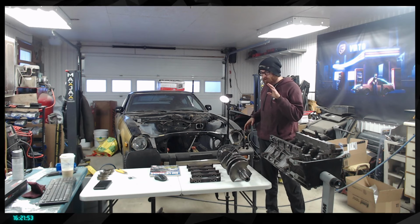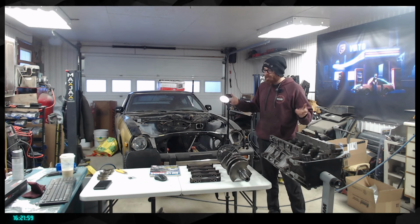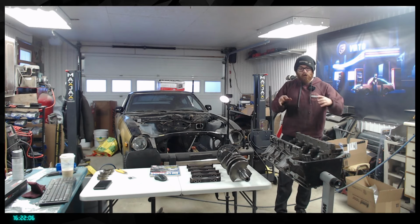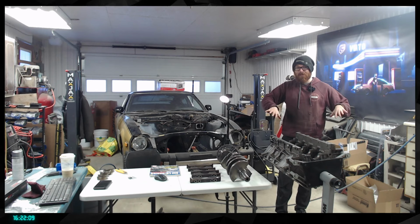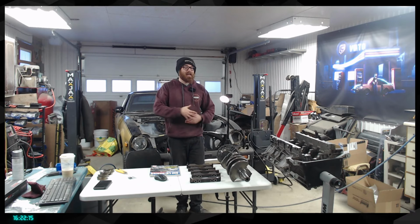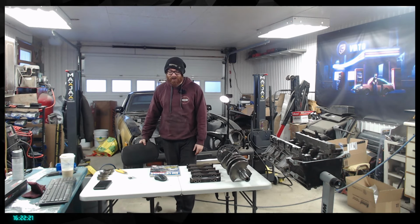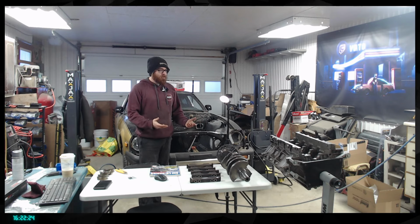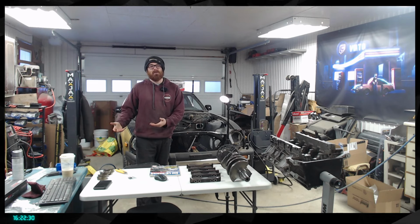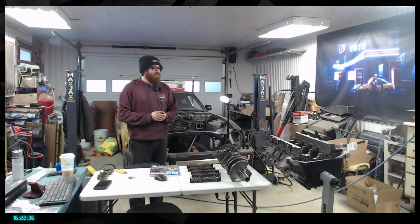Tomorrow, for sure, we're going to be able to start measuring the crankshaft and everything. One thing I was not expecting, but is actually the case, is that we're going to put a lot of parts together and leave them in place until we are done measuring everything. Then we're going to disassemble everything again and clean up absolutely everything until starting the final assembly. So it's going to start to look like an engine, until we remove everything and it's not looking like an engine anymore, so that we can set everything up and then assemble everything for one final run.